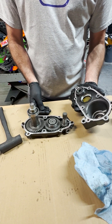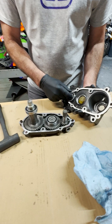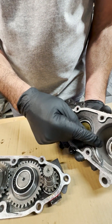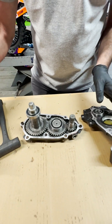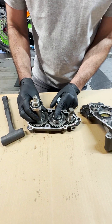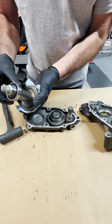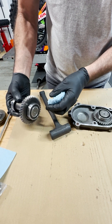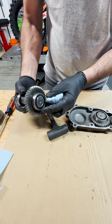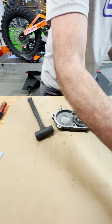There she's open. It's pretty simple — just three bearings, two seals, a plug, and three shafts. Let's pull out that shaft. There she is — broken shaft. Just pull off the bearings; you may have to tap them off. But we have new bearings to go on with the new shaft, so we're not going to worry about this one. We're going to set it aside because it's done.